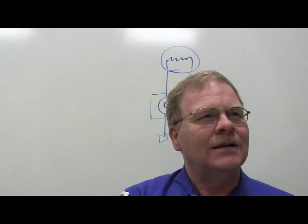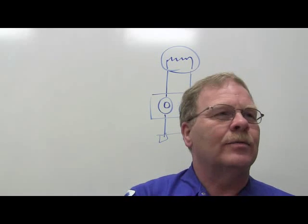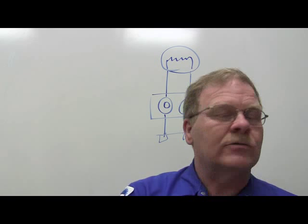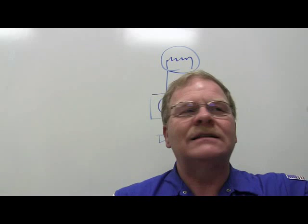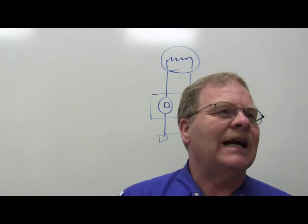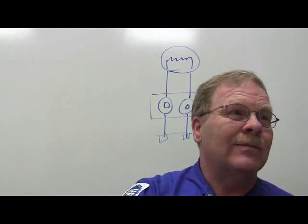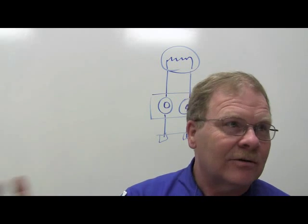See what I'm saying? If you gain another graduation of water, you've got 10% ethanol. It's going to mix with it. It's going to leave the gas and mix with the water because it likes the water better than it does that. And that's as easy as pie to check the gas and all that. The more ethanol they put in these things, like these people that work on lawnmowers, they have a booger of a time when that stuff's got ethanol in it because they don't like to run right.